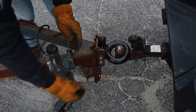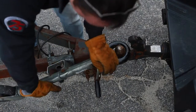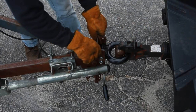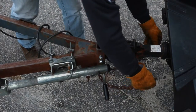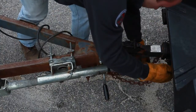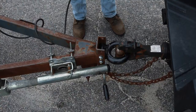Once the weight is off the jack, you can pull the pin out and flip the jack up out of the way to close and lock down the pintle hitch. Then you have your two safety chains, one on each side. The chains should be crossed once so that if the trailer came undone, it creates a cradle for the hitch to land into in an emergency situation.